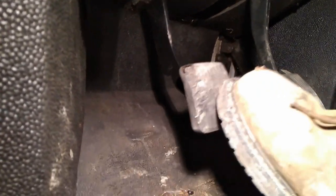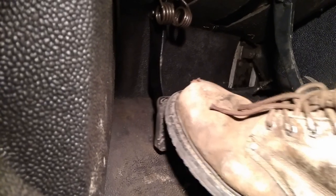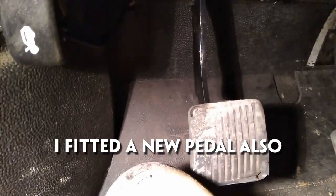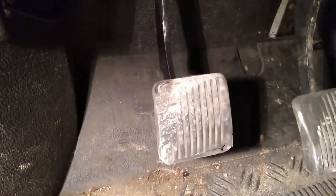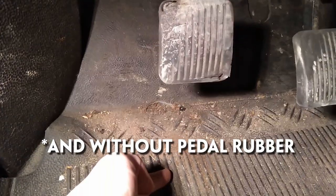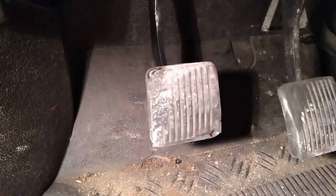There is the finished pedal. Free play is about that much now — very nice firm action all the way to the bottom, hardly any play in the pedal, and no squeaking. All the adjustment here is just getting the bottom of the pedal to the floor without the mat on — make sure that's 140 millimetres. And jobs are good.